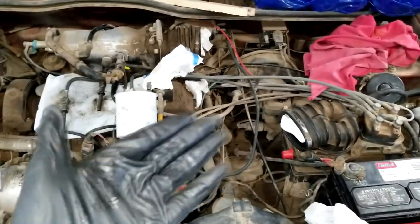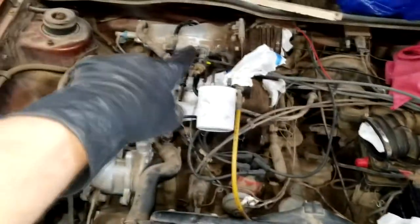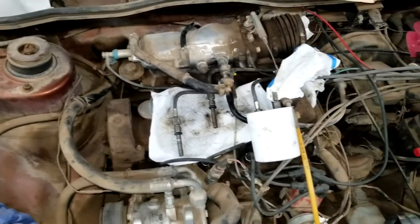When you press it up, simulating air flowing through, it'll allow fuel to flow out of this little distributor unit and to all the injectors, and we should see them all squirt out. We're just gonna check and make sure they all look pretty similar flow-wise. Here we go.